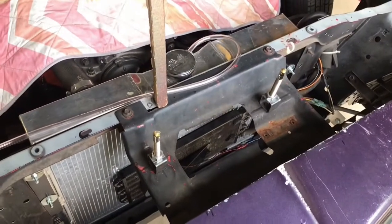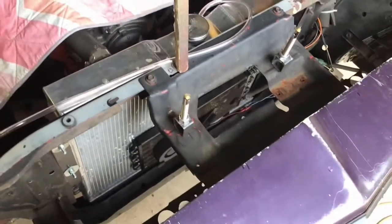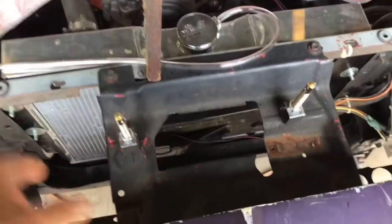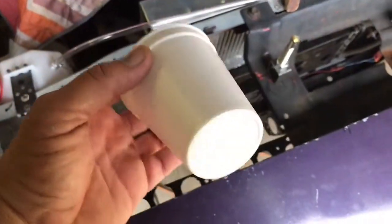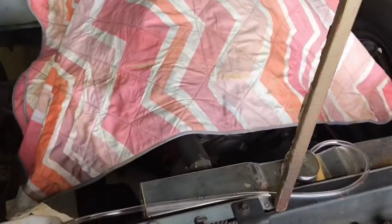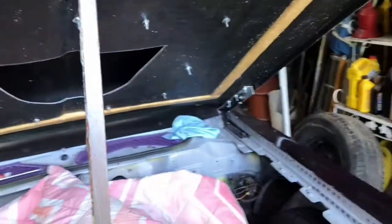I don't like being out here in this shop - this is one of my aluminum buildings - and it's so hot having to close the door, it was just really brutal. So I packed up, went in, cleaned up, and got something to eat. Back out here today. I've got the pins installed and put a little grease mark on them so when I close the hood I'll know where I need to drill. I'll poke my drill through the bottom of a styrofoam cup so the shavings will fall into the cup. I've already tested this - you can see the little grease spot right there and right there.